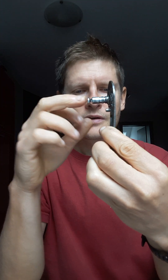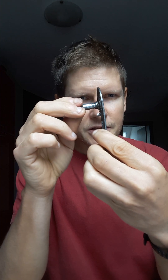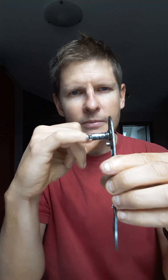When you cross the chain — for example, a bigger chain ring in the front and a bigger sprocket in the rear — it has an additional pulling force in this direction. This is why this damage happens especially for people who don't use the gears in the correct manner as the manufacturer prescribes.